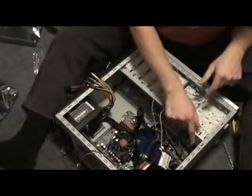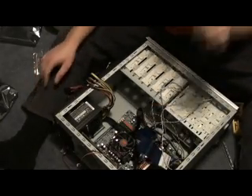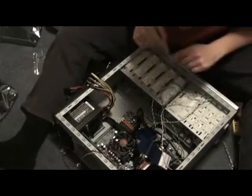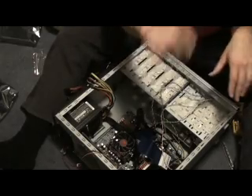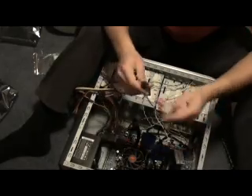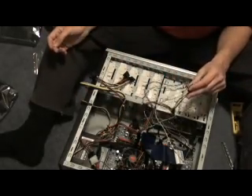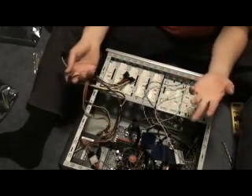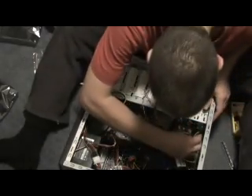What I've done is plugged the hard drive IDE ribbon cable into the hard drive port and into the IDE port on the motherboard — you'll see it, it's green on this one. It can only go into one spot. There'll be two IDE ports; one is the main one and the other is in case you have two hard drives. Your hard drive also needs a power connector. If you're using a SATA hard drive you'll have a different power plug — same power supply, but a different connector.